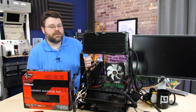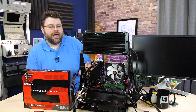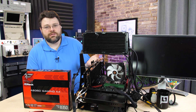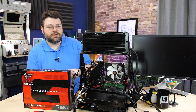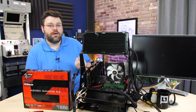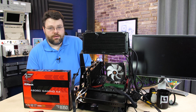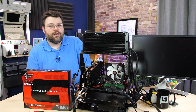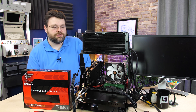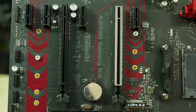This is actually pretty cool. I've got the older Intel 750 NVMe, and it's hard to use that on Ryzen because most of the time you would have to use a PCI Express NVMe through the chipset — either the X370 or B350. With this, I don't have to do that. It doesn't have to be NVMe though. You could also run 10-gig Ethernet, another graphics adapter, whatever. If you are going to run multiple graphics adapters, though, you should know that in the UEFI, there is no way to specify which graphics adapter gets initialized first. It's always going to be the main slot, then the x4, and then whatever's hanging off the B350 chipset.